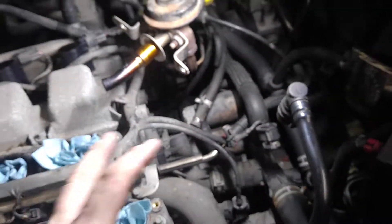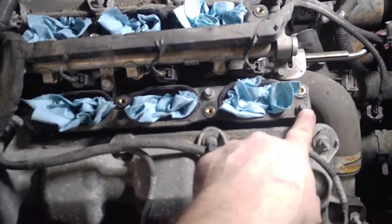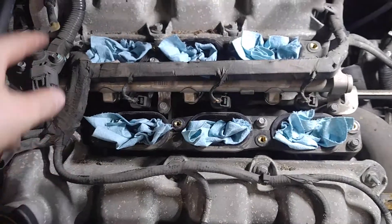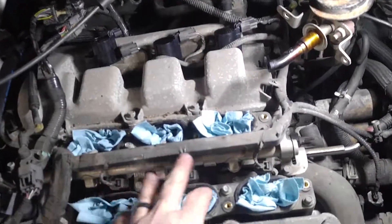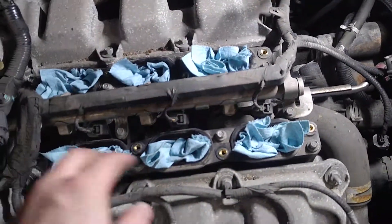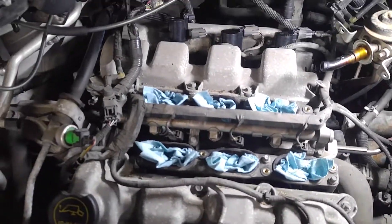Just check all the way around it. You won't need to take out this bolt — you'll see that one — but there's only four bolts on top and four down inside the plenum. Once you do that you'll have access to the back. If you need to get to your fuel injectors, they're right here as well. We always just put rags inside the air intakes so nothing falls down in there.